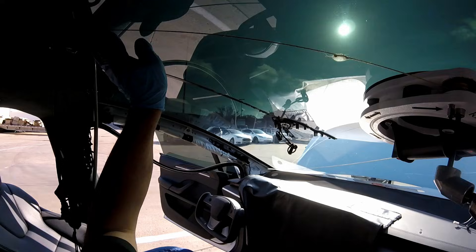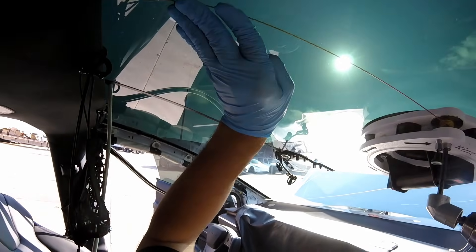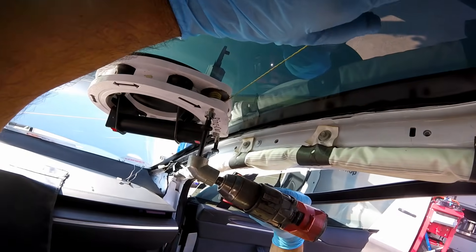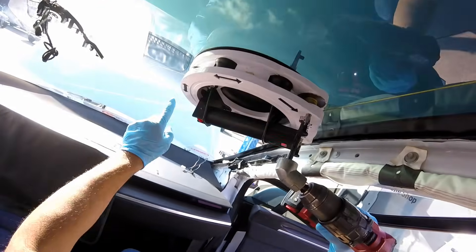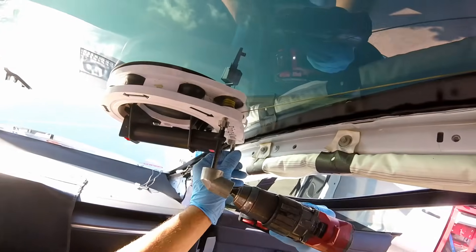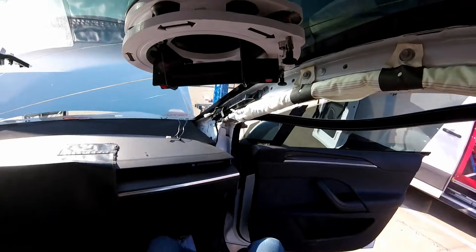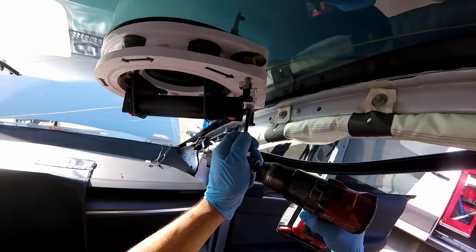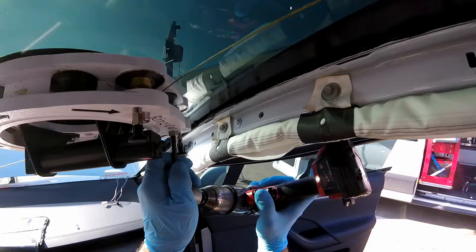That line right there is going to cut. The line is older so I go slow here because I feel a lot of tension, and the roof and all that. The line is starting to burn in this one. I can lock it. I don't have much angle so I can run this direction, but not right now — I'm going to lock this guy and unlock this one. I'm going to support my drill with the body because there's a lot of tension here. Careful with the airbag.